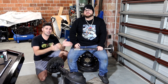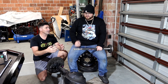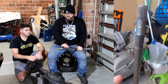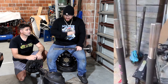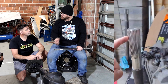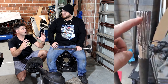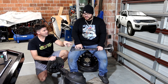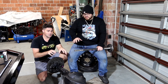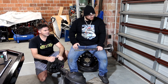So we've got Ben's brand-new shafts that he got cut down in Perth. Ben, tell us what this is, what it's from, and how you've made them mix together. So the shafts we had in the diff originally were not usable — they're just not the right sort of thickness. So I was able to get shafts out of a later model Triton, which is wider. That way, the machinist was able to machine all the splines back into it, make them nice and long. He has shortened it, but long enough that we're able to make it fit into our diff. And that's from a diesel — it was the same thickness on the very end but just longer. So from that, it was an ML-MN shaft into an MK shortened diff. And it's cost him around about $1,000 to get to this point — with the diff, the shafts and everything, all-inclusive. Not too bad. Let's try and do these bearings and slide in and see if this is actually going to work.